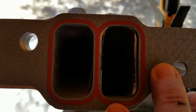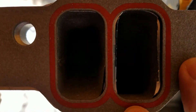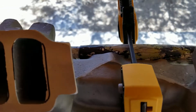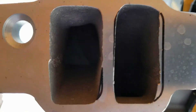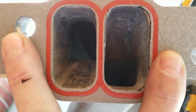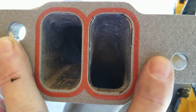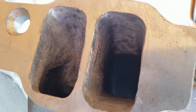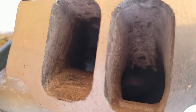The intake manifold definitely has some quality issues, and the intake runners — it's just obvious from looking at them that they're not quite right. So I took an intake gasket and that same fine-tip Sharpie and traced the openings onto the manifold to give me guides on where to trim to get a more uniform opening. All of the intake runners have been gasket matched; for several I took out a bunch of material and did some minor porting. Any ports that had bosses down into them, I cut and ground those out and blended them back in. Where I needed to widen the ports to gasket size, I also cut that material back into the intake runner as far as I could.